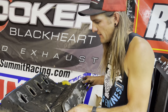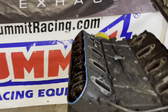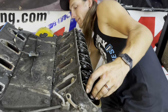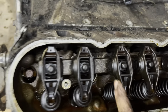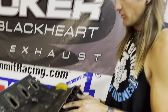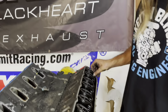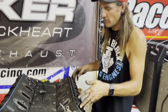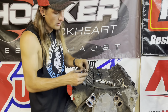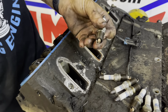I can tell both valve covers have been off. One gasket is brand new, all these grommets are new, and these bolts look degreased. But yeah, cooking here too — not sludgy, very dirty, but definitely not sludgy. And notice how much cleaner this is than the C5 one was — 280,000 mile trucks compared to even high mileage worked Corvettes, these things are always worse. Plugs are all out, they look old — definitely not original but they've got some miles on them. Under closer inspection: this cover is new, the rear main seal cover is also new, and somebody did this valve cover gasket.